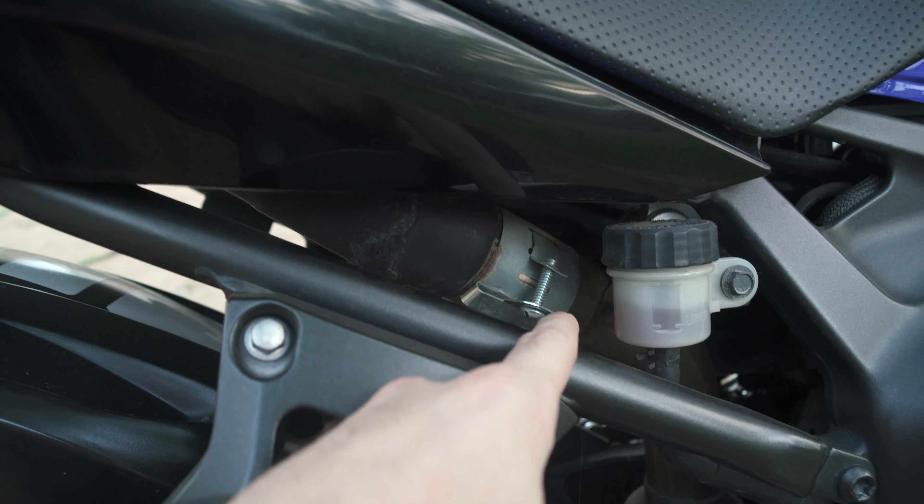I did this one first — so I did this whole pipe here, just back into this one. And then I took it off the bike, put it back on, and then marked where I needed to cut the hole. And then I welded those pipes together and back into the second muffler here. So anyway, that's pretty straightforward — it's not too hard. You just have to do a little bit of thinking and you'll be pulling the exhaust system off and on as you're doing it. But as you start building it, you can definitely get a feel for what you need to do.